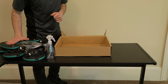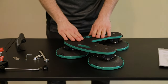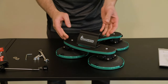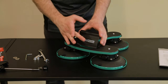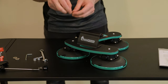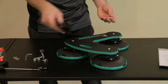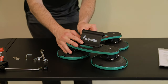The only assembly we're going to need to do before putting this on the car is to actually bolt the bike mount onto the rack. You're going to want to find the handle portion, and it's going to go with the logo facing forward. We're just going to put a couple of these allen bolts through the holes in the top, then put a washer and a nut on the bottom, line up the holes, and get the bolt started.